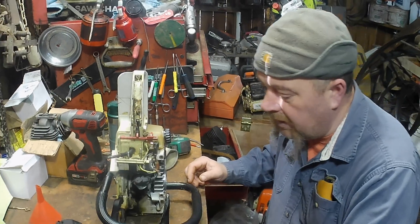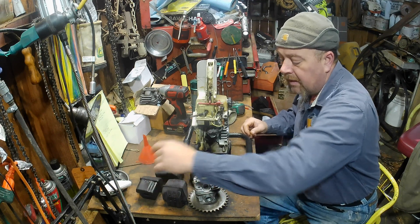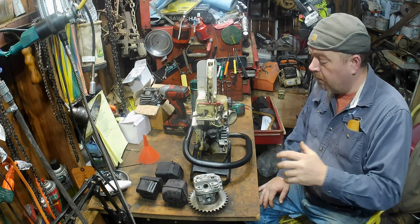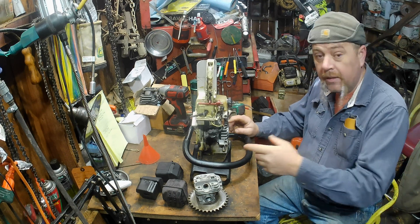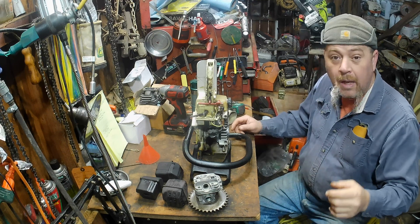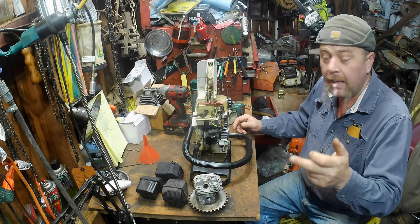After that, we're gathering goodies for muffler mods. This one here has already had a muffler mod — that's the one I've been running. I've gutted another and started collecting pipes in different sizes. We've also started collecting data for parasitic drag of two rings versus one ring. It's amazing how much calculated horsepower it takes just to turn two rings. So coming up: possible machine work, muffler mods, single ring, and dyno tests.